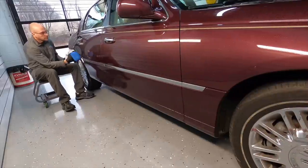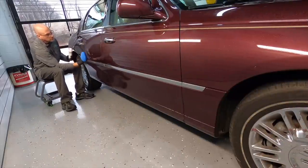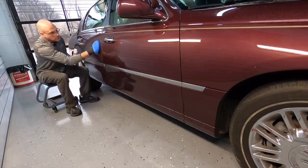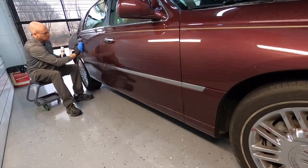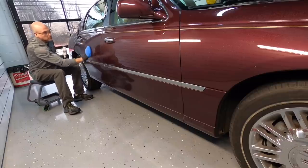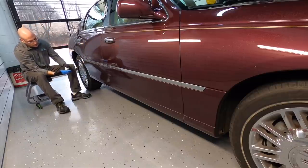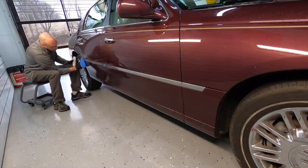This is a car brought in right after it has been washed — it's still wet — and it's the perfect time to get out the paint cleanser. You can't skip the clay portion of the decontamination; that's one thing it will not remove: bonded contaminants. However, the road film that clay will not remove completely, this will, and it will create a clean slate.